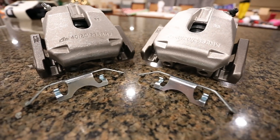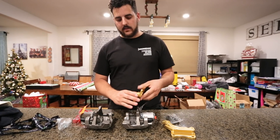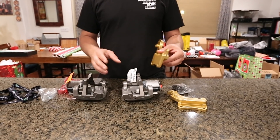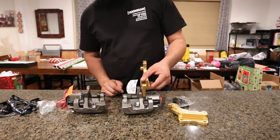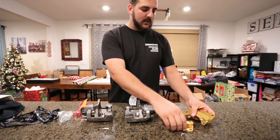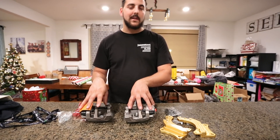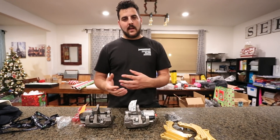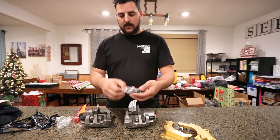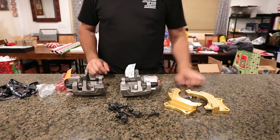The way they do this is they take a set of E39 rear calipers and build these custom machined brackets, and then you can adapt those to the car. This bracket here will have to be installed onto the trailing arm, hub, or spindle — whatever you want to call it. The E39 brakes will go onto the Drift HQ brackets, and that will allow us again to have a hydraulic handbrake that's a separate system. They also include the hardware for the brackets to be mounted to the trailing arms.